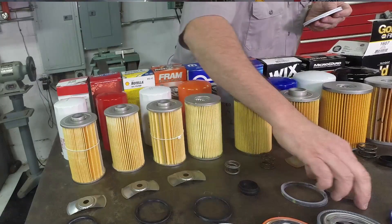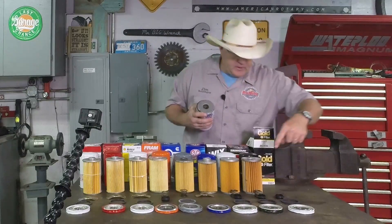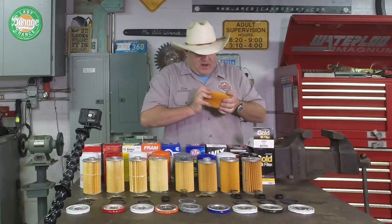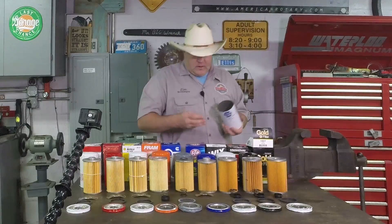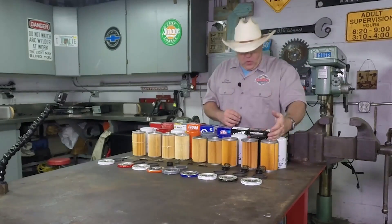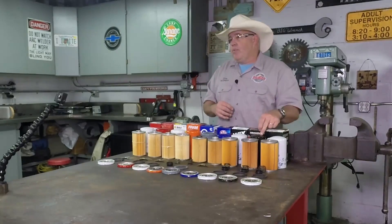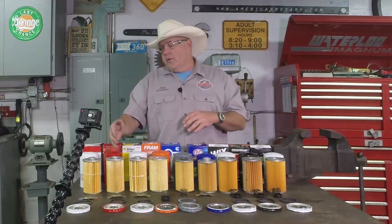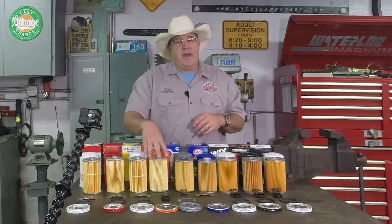Pulling out the Napa Gold here — same heavy duty gasket that we found in the last three, matching the OEM. Very heavy base plate. A little plastic joiner identical to the last two. Filter is the same — very consistent pleats all the way around, joiner bar to join it together, very very stout, also hot snotted in. Oddly enough it looks like the last two. Another heavy duty spring. So here's what we got: without a doubt the Wix and the Napa Gold are identical filters — the same filter under a different brand name. Surprisingly, the O'Reilly Auto Parts house brand is also the same as the Wix and the Napa Gold. The STP filter very closely mimics the Purolator, the Rotella, and the CarQuest filter, but it is a different filter — stamped a little bit different. The OEM filter stands by itself, as does the Fram filter.